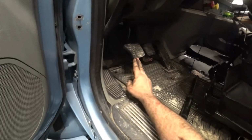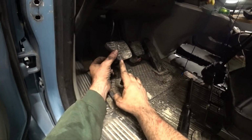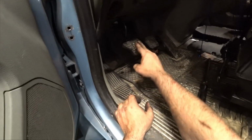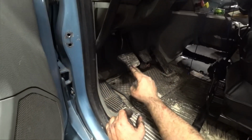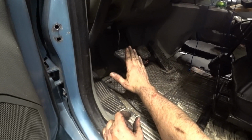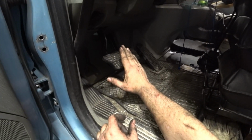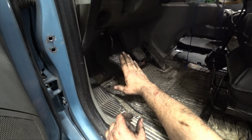I usually do about 1.5 inches. See, if you were to measure this from here, I usually have about 1.5 inches. Now, I've seen guys do like 3 inches and some. Usually 1.5 inches, and what that is, you set your foot on there. In the old days, if you just pressed your foot on there, it would turn your Jake brake off.